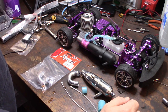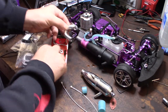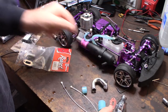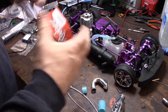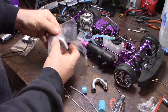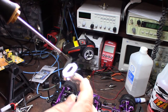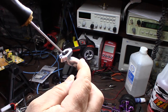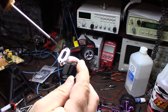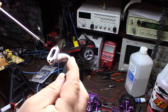I live down here at the beach and bare aluminum corrodes really fast. When I first bought this pipe, I couldn't tell from the pictures whether it would fit this 90-degree angle at the header pipe. So I bought an extra one from RedCat just in case. Looking closer, I noticed the Amazon pipe has a very sharp edge inside — you can see the light reflecting off it. The problem is sharp edges on an intake or exhaust system will create a whistle, and I've seen that problem numerous times on aftermarket high-performance throttle bodies.